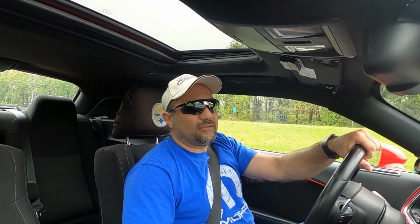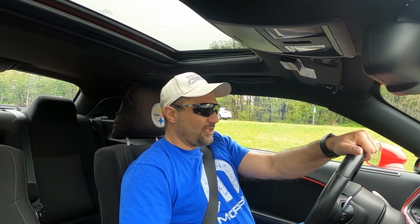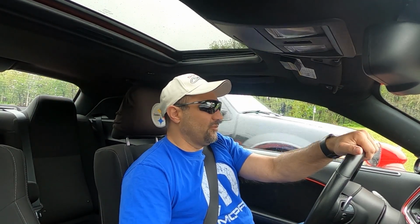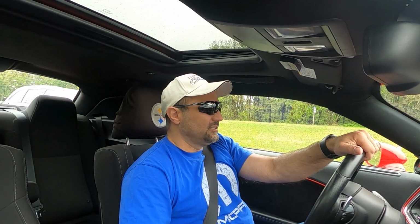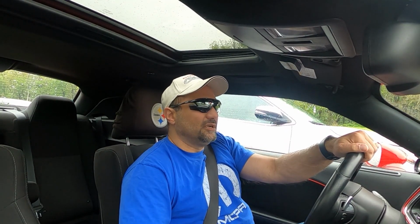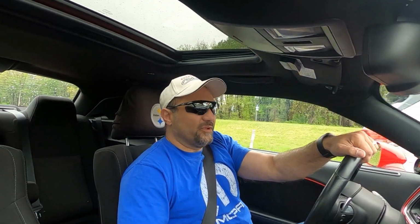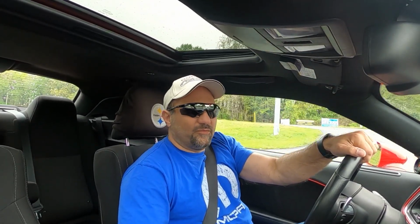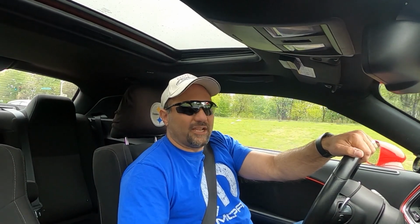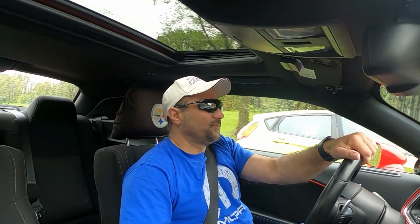And if you're not worried about warranty, I would start with a base tune. I would go ahead and get my PCM unlocked, get a Diablo or HP, whichever way you want to go. That's up to you. And get a good, if you can get 93 octane, a 93 octane tune. If not, get whatever the highest octane you can get. I think 91 is the next best, for people that don't have 93.